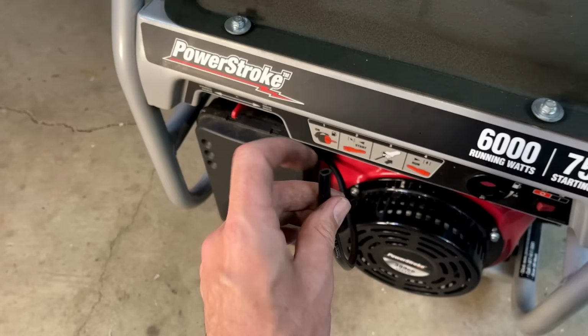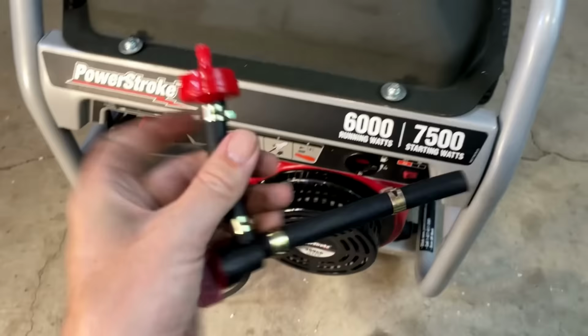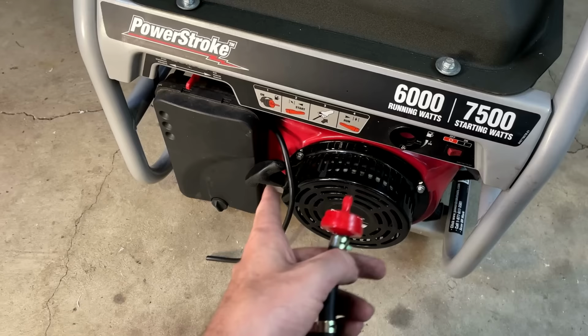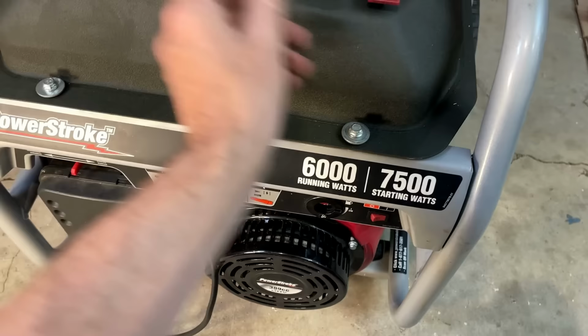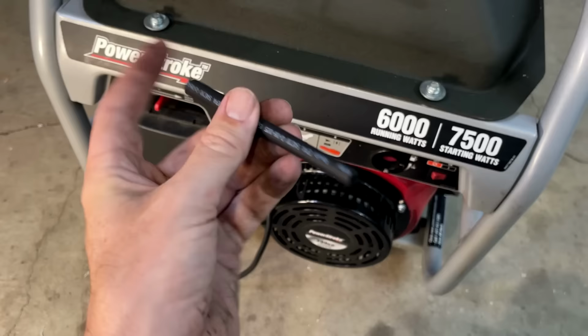But this one is a little bit odd because the tank needs quarter inch line with a quarter inch valve and a quarter inch fuel filter, and that has to connect to a 3/16 line. The thing that makes that possible is a special line which comes after the fuel filter. I already threw it away because it was all gummed up, but I do have one from a Ryobi. This side is quarter inch and it reduces to 3/16.